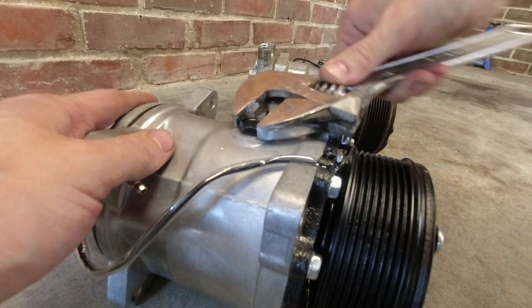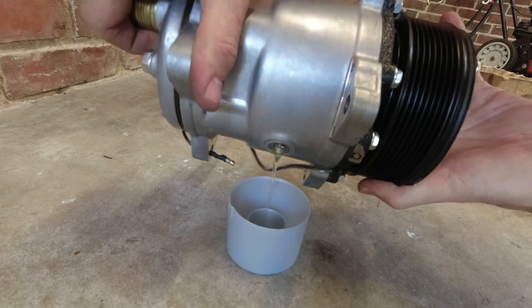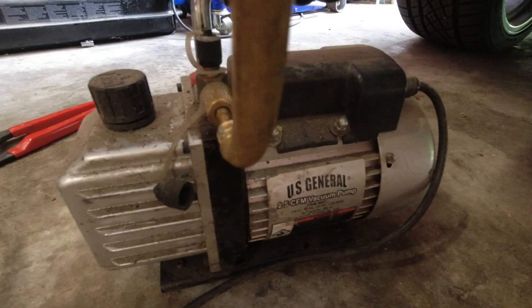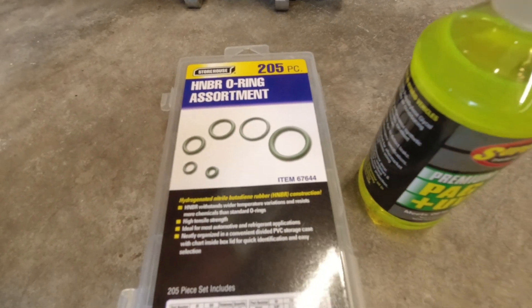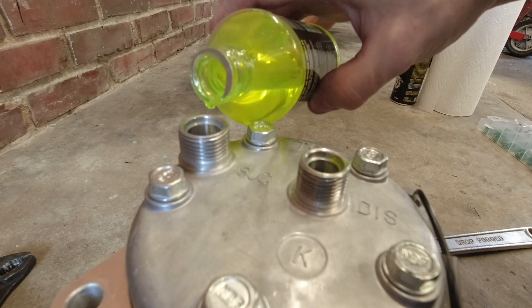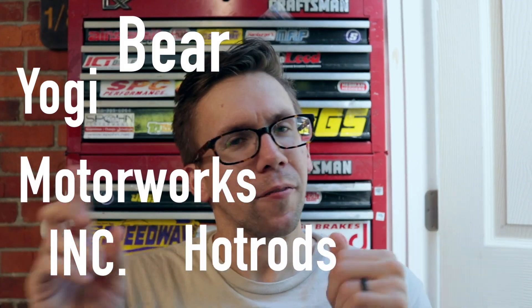That's the reason why you got to swap the oil out of your AC compressors. The oil that comes in these things — I've seen every color of the rainbow come out of it, from straight-up black goo to oddly clear to menacingly tan and brown. I don't know what they put in these compressors in China; they always say they are factory filled with oil. This Harbor Freight vacuum pump has run on new take-out AC compressor oil for over a decade and it doesn't sound so hot. Fill it up with fresh PAG oil — 100 or 150. Go ahead and put dye in there, because you've got two options: put dye in it now so when it leaks you'll see it, or put dye in it later when it leaks and you'll need to see it. Go ahead and put dye in it now.